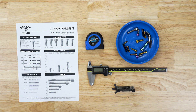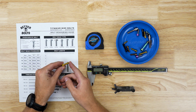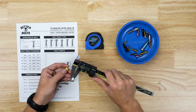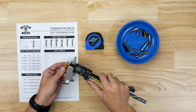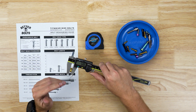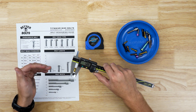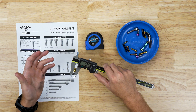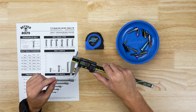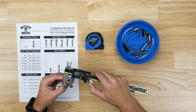So let's go over what that M means and how we can get that number. Here I'm holding an M6 bolt, and the reason I know it's M6 is that the diameter of the bolt shaft measures six millimeters — 5.88 is close enough to six. It's best to round up to the nearest millimeter or half millimeter. You're really only going to measure to half millimeters when talking about something very small, like 2.5 or smaller.